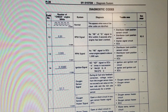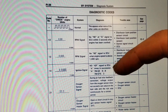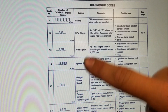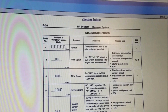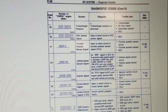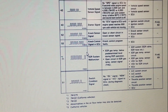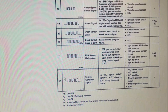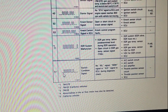This is directly from the factory repair manual but it's actually all online, so that is in the description below. You can see here all the codes, what it looks like, and then of course what the system is. I can scroll through — and there, yes, I knew that one: since I deleted my EGR I had a feeling it was gonna be code 71 with the EGR system, and then yeah, code 51 — this one's a tricky one to diagnose but I had a feeling I would have that one too.